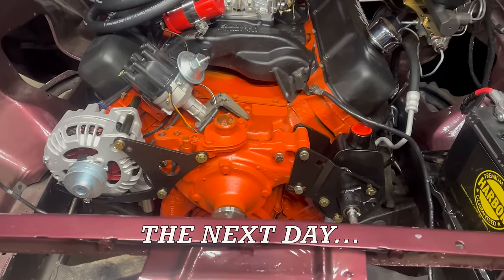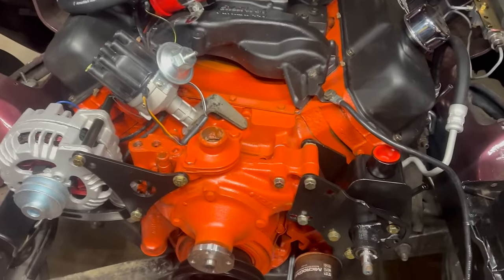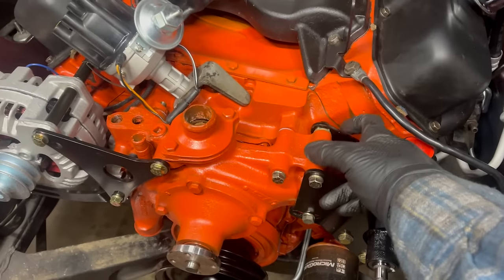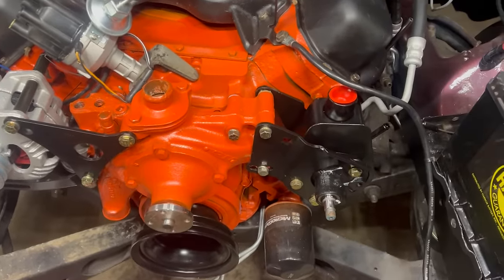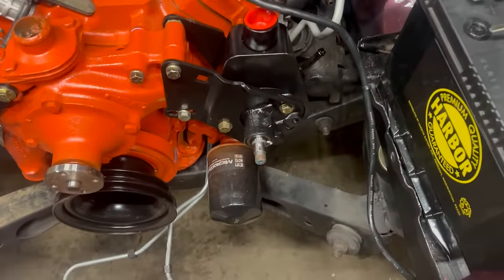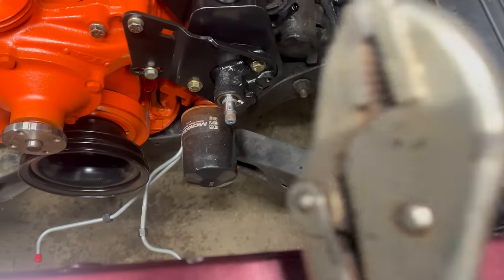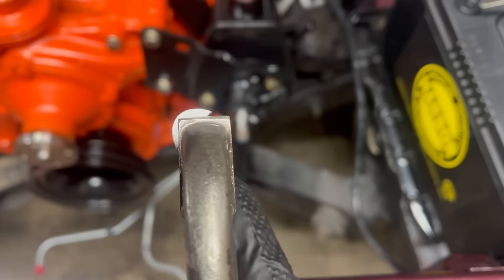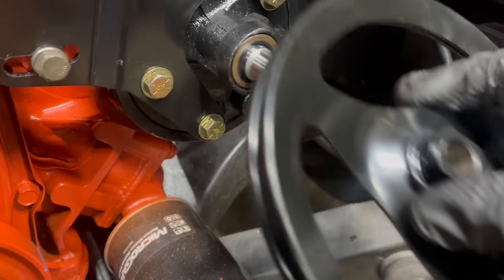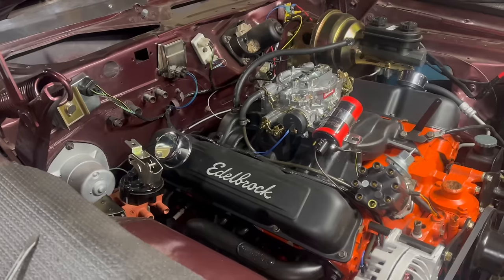Back on accessories. Lots of fun. You know, they include just about all the hardware you need. Brackets, bolts, all that. I had to add some washers here because for whatever reason the brackets were a good bit too wide. Now I'm trying to put the pulley on, but the one thing they didn't include, a Woodruff key. So I had to go find my assortment of those, find one that's the right width, and modify it extensively on the bench grinder. Should be close now. Yay!